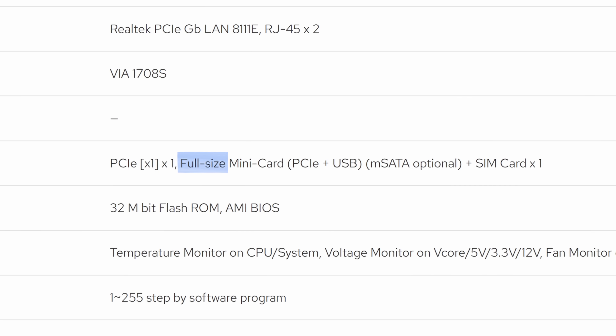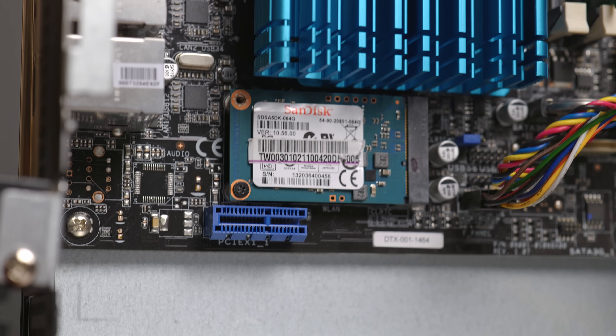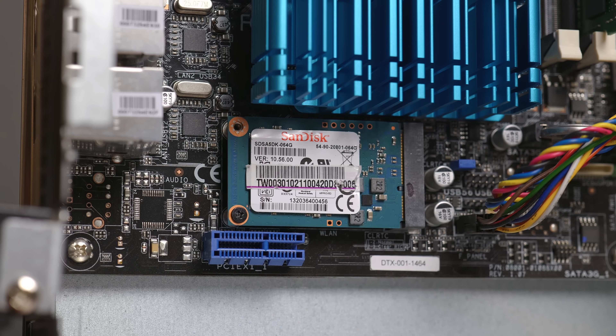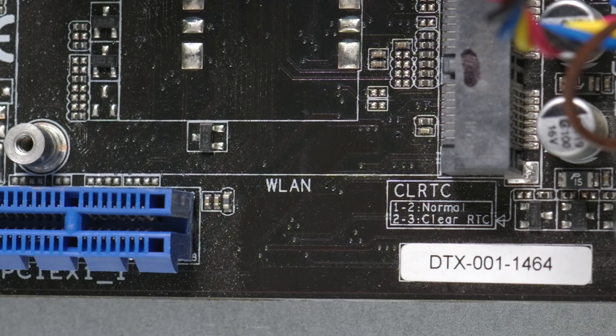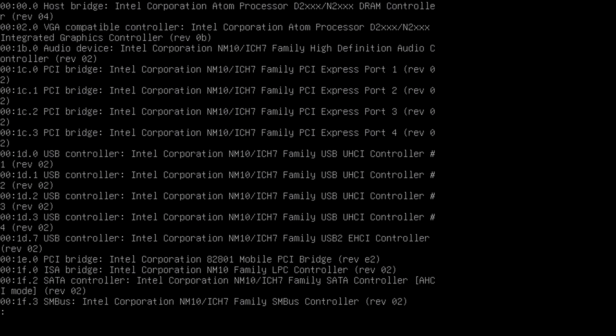There isn't another PCIe slot, but according to the specs of the EMB-CV1, it seems that the mSATA slot was also functional as a mini-PCIe slot. Mini-PCIe and mSATA share the same physical connector, but often they aren't wired up for both. I assumed this wouldn't be either, but the specs seemed to indicate otherwise, and the board even had 'WLAN' silkscreened on the motherboard. So I dropped in a little Wi-Fi card and booted from a Debian live image to test it out — but my assumption was correct. This in fact did not work. I'm assuming this was another cost-cutting measure on these boards, but realistically it wouldn't have made that big of a difference anyway, since I need something to boot from.